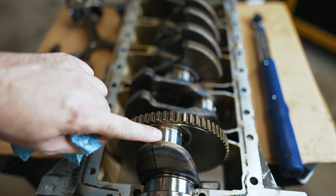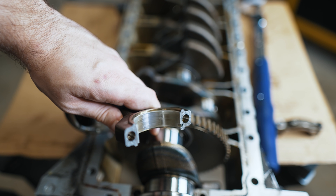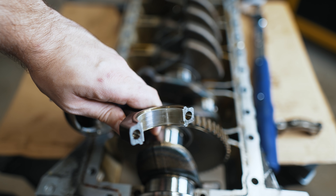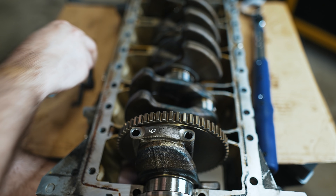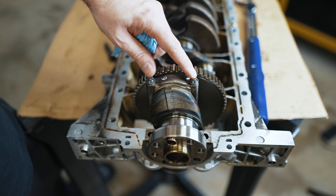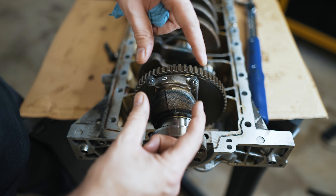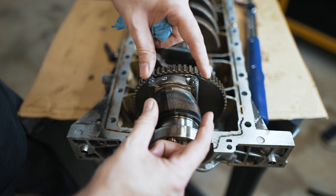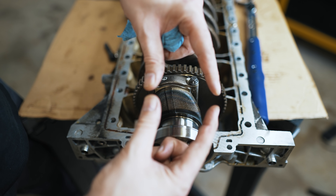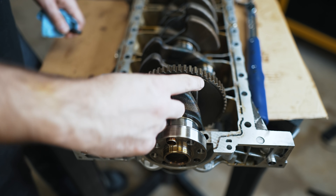We're going to bring over the stock bearings now — I'm glad I kept them. I labeled these cylinder six lower and cylinder six upper. By the way, that's the condition of my stock bearing after 200,000 miles; I changed it for maintenance, but it would have lasted quite a while longer. In my opinion, the difference between one motor spinning a bearing and one motor surviving would be the strength of these rods and how much deflection they have, so that the bearing can stay a perfect circle under load. Like an N55 — if you push it a bit too hard, you may actually spin a bearing because the rod starts to flex. The N54s are pretty strong, up to about 550 to 600 foot-pounds of torque at the wheels.